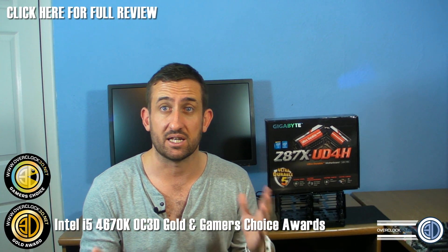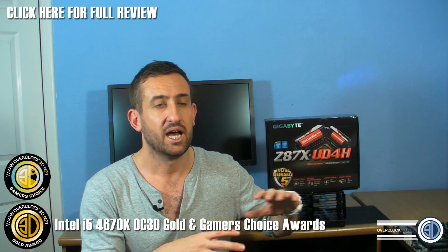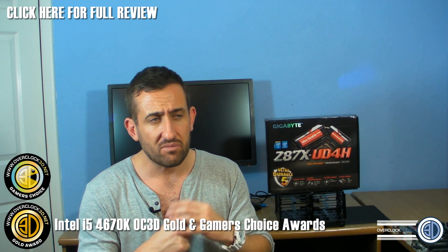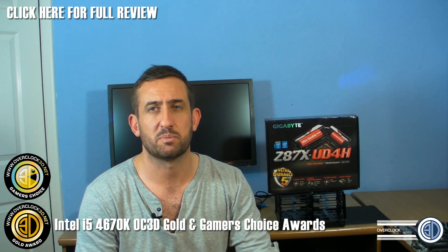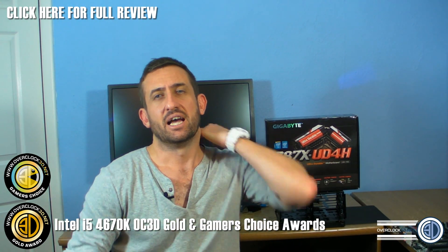You do need to balance things within certain amounts. Generally, graphics is where you want to be spending your money. You obviously don't want to be putting a £500 graphics card with a £50 CPU, £25 RAM, and a motherboard you found in a skip — you do need to balance things out. But within reason, graphics is where you want to be spending the majority of your money. If you're just gaming, that's the way it swings. When you start talking about heavy rendering or heavy Photoshop work, then yes, you may need more CPU grunt. And the other thing I'd say — spend money on a solid state drive, because SSDs keep your rig super snappy. You don't want to be waiting for a hard drive to spin up.